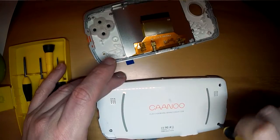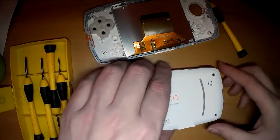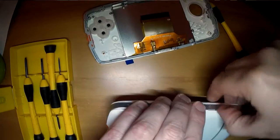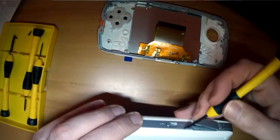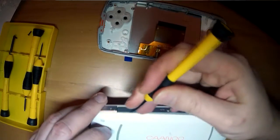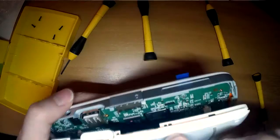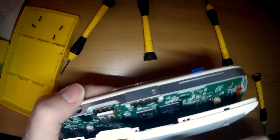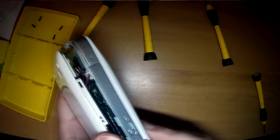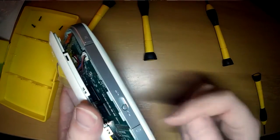I pulled the back off by taking the four screws out, and the back doesn't come off as easily as you'd think. It's like an iPhone — you've got to actually nurse it off. Guitar picks would work well if you had four of them. I personally used a fine gauge screwdriver to go under the clips. There are four clips along the bottom, four along the top, and two along the sides — keep in mind where those clips are.